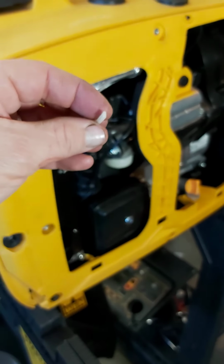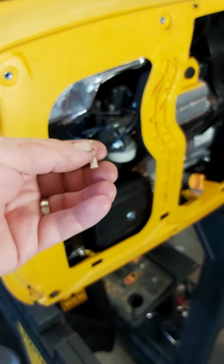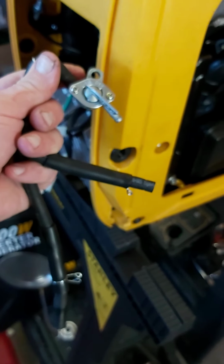So what it came down to was an issue with the carburetor. It was a couple of things. So I took it out, cleaned it, and I temporarily put in a little shutoff valve for testing. And I noticed the fuel flow out of the tank was not what I expected, or not what it should be. So I started to investigate some more.